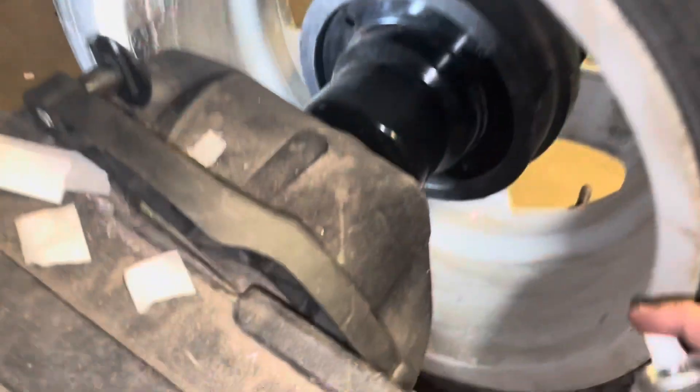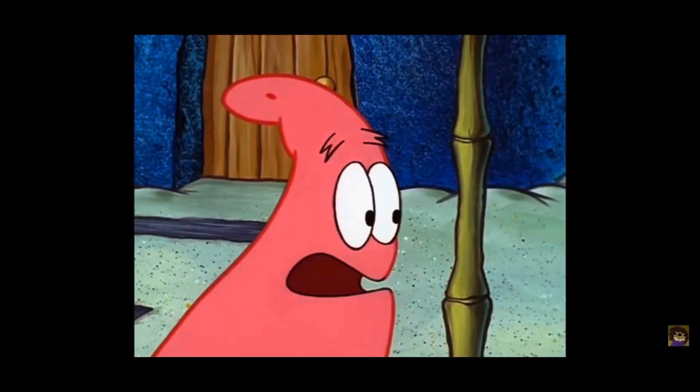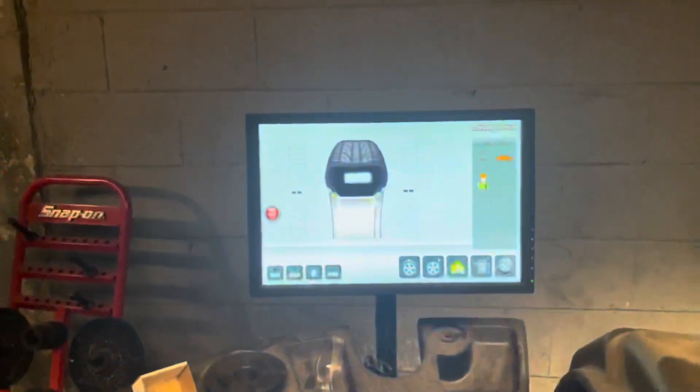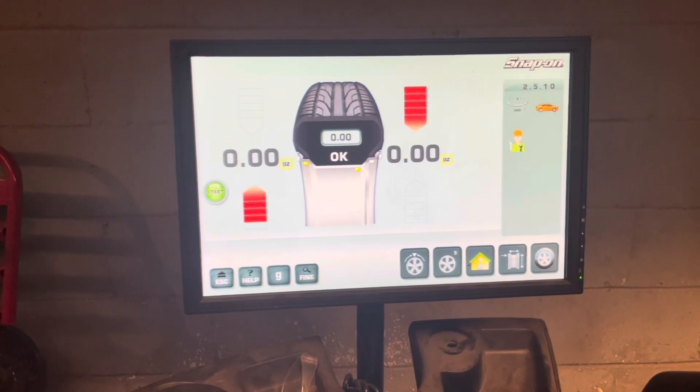We'll take one of these clean rags — each one of these weights is a quarter of an ounce. Two quarters. Hey Sponge, can I borrow another quarter? We're still green up there. So according to where the laser was, that's where it'd be. For the left side the laser kind of does the work for you. With a crusty paper towel we only need one quarter — that looks good to me. Now we'll do one more test, make sure that we're running zeros. And that's what you want right there.